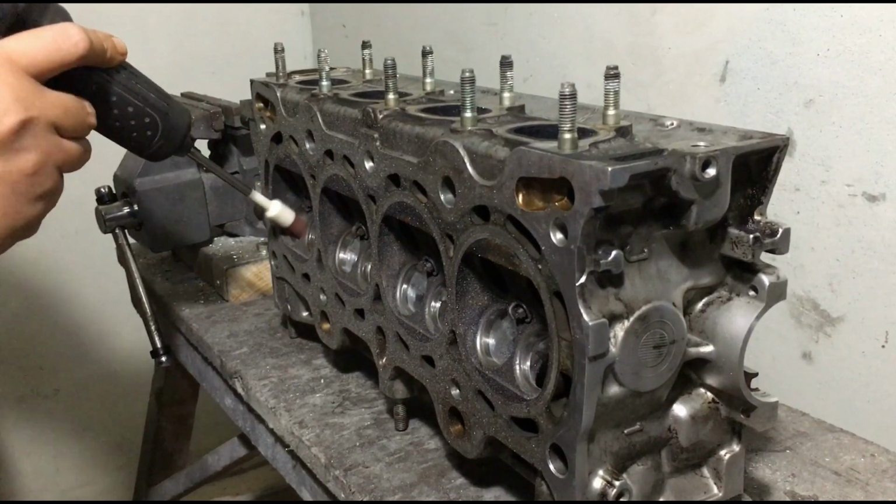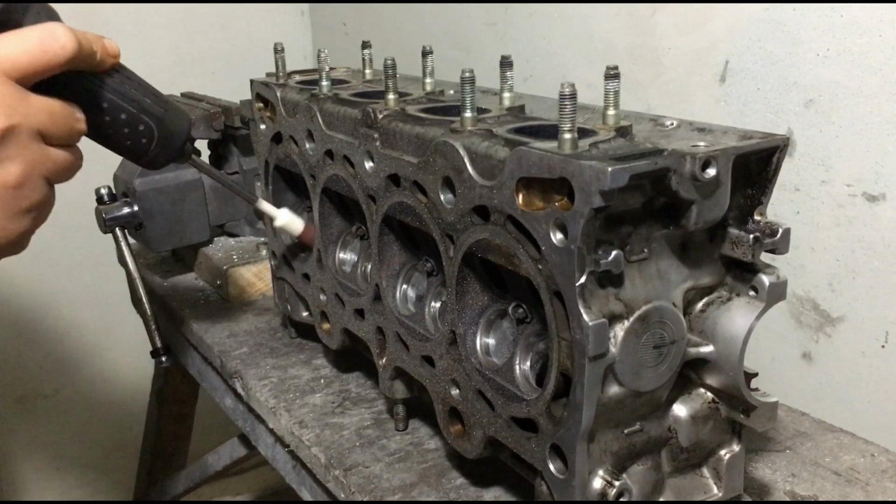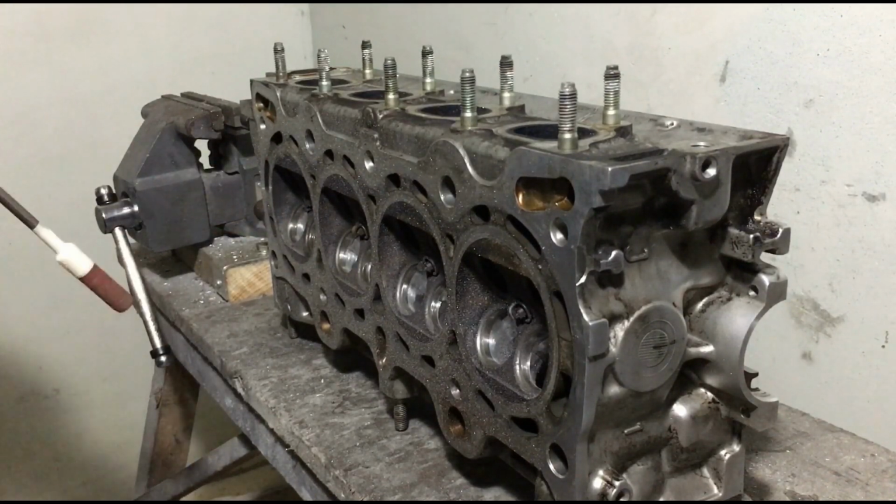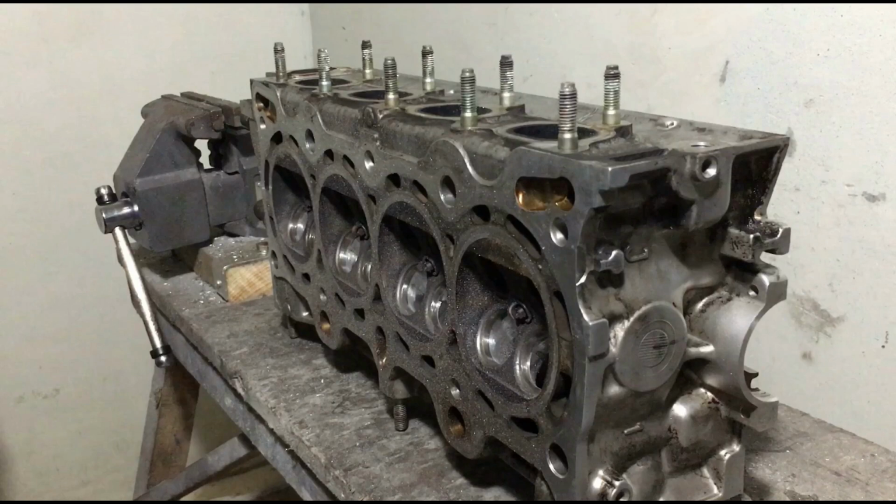Alright, it doesn't take too long to finish smoothing out the short turn because you don't have to take a lot of material off it. Now off to blowing air so that dust particles are less, and then off to the clean desk. That's the initial stages of porting, or bowl work or fluff and buff. Actually, that is exactly how a Type R head is ported.